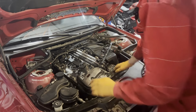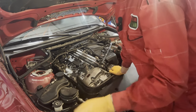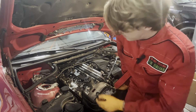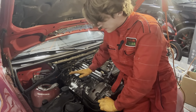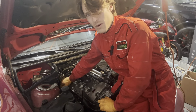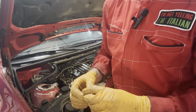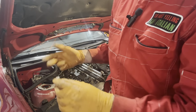We officially remounted everything. I still have to torque them — always double-check your owner's manual or online for the correct torque spec for your model. I don't have a torque wrench so I'm waiting on that. I'm already starting to remount everything else. Keep in mind: for this tube with oil, when you removed that big 17mm screw, you need to add the two copper washers that came with the kit — always replace them or you'll have another oil leak.